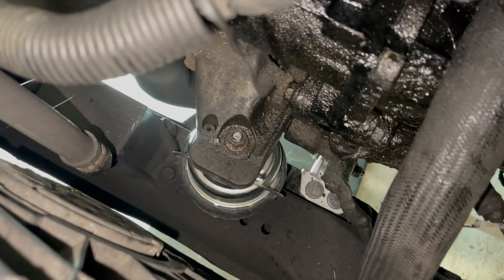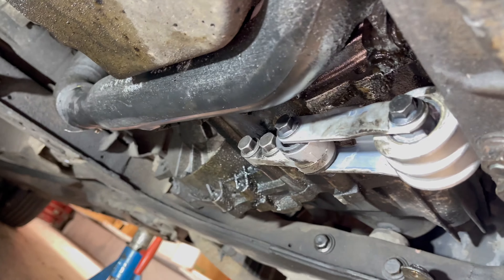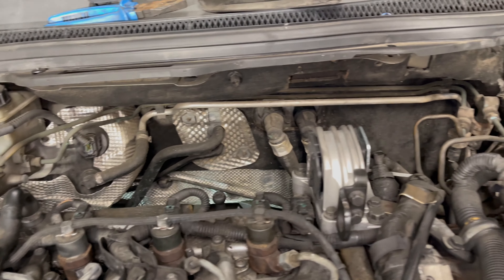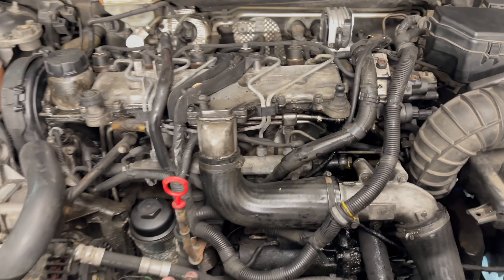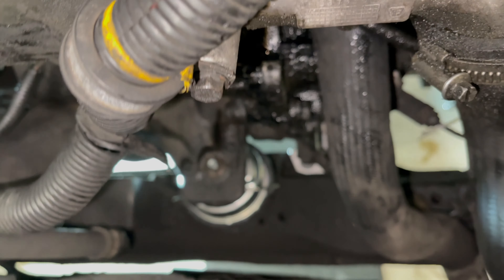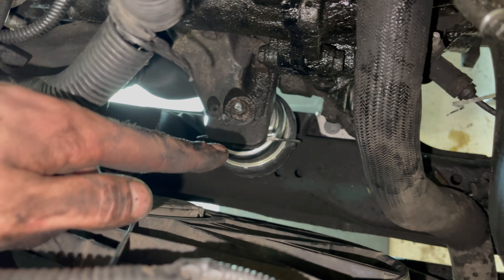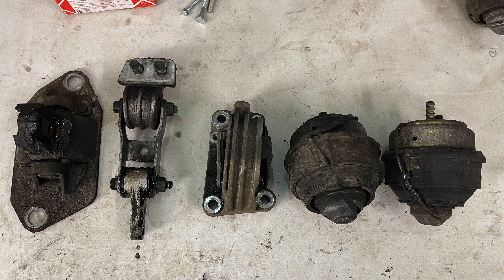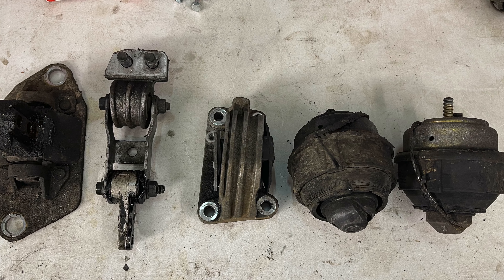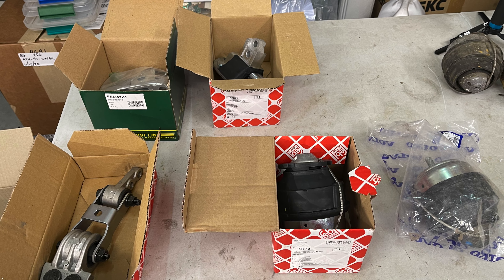Once you've got the front mount all tightened up, check the rear mount again and don't forget to put the bolts back in the torque rod, then you can replace the crossbar and you're finished with the job. Obviously if you did have the vacuum hoses attached, you'll need to refit the junctions and refit the vacuum hoses to the front and the rear. Thank you for watching — I really do hope this video has helped. If it has, please do take the time to like and subscribe and check out my channel for more videos on this car and many many others. Thank you.